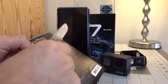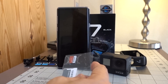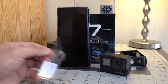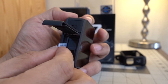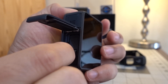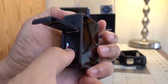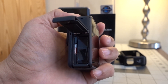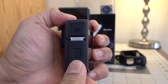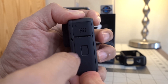It is also recommended to format your SD card so it will be in good condition, but first make sure you save all your footage and photos before reformatting. With the camera off, insert the SD card into the slot with the logo facing towards the LCD or backside of the GoPro unit, then close the cover to seal the battery compartment.